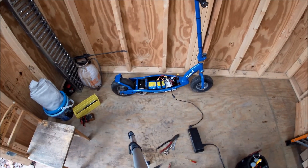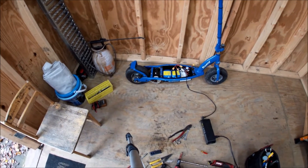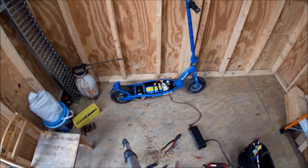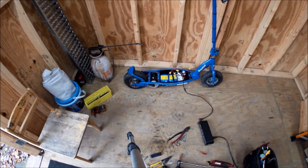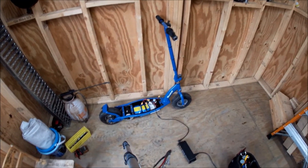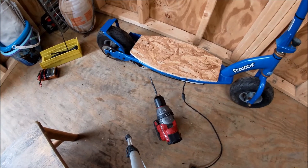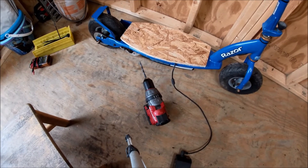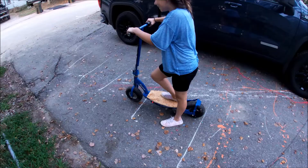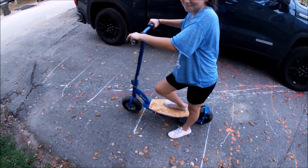Well, I got the bike charging. I thought it was going to be a little faster. The motor is twice the size and we went from 24 to 36 volts, but it still seems pretty weak. We'll see what happens when the batteries are charged — didn't even put a brake cable on it yet. We might not need to unless the thing speeds up. So I made this sweet plywood platform really quick while the bike's charging — just going to drill two holes in it and secure it in place. Alright, we're going to do a quick test. I just pumped up the tires and got the batteries charged up to about 41 volts.